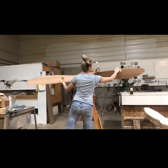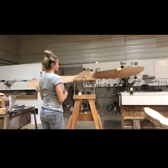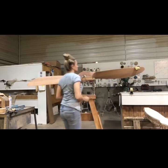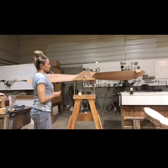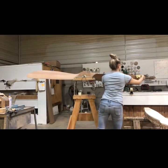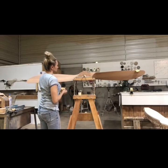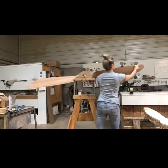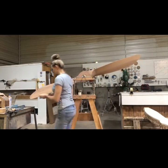The very first thing I do is take a measurement and see what I'm working with. I'm using little pieces of sandpaper on the blade to check and see how far I'm off. This is a bigger prop, so I was three pieces of sandpaper off on this one. Normally it's just one or two pieces, but considering the size of this prop, it took a little bit more.